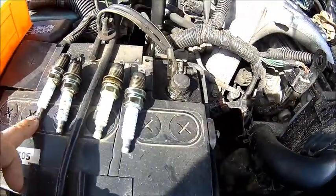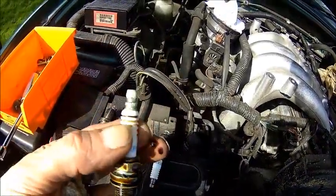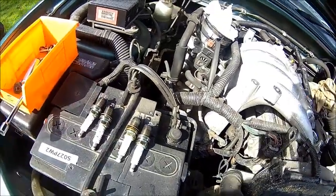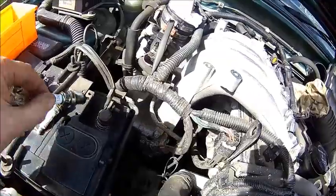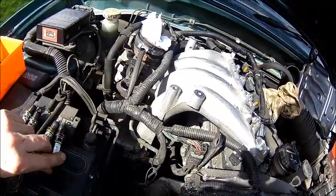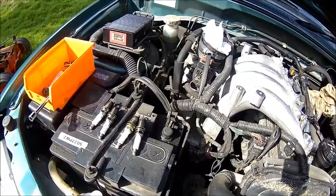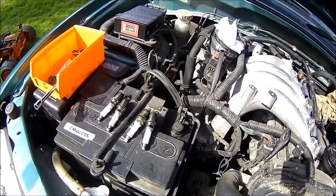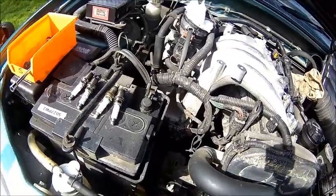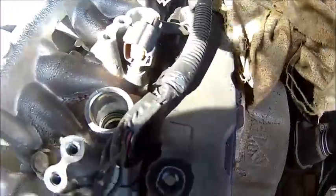Here you can see the situation. That's number one, two, three, four. Number three has some significant corrosion. And the holes down there are pretty oily. So we need to find some of these spark plugs — they're FR5B. I'm pretty sure I don't have any of those; it's a very odd bulb-style spark plug. Worst case we just clean it and put it at the front. I'll also run a rag down there to get the oil out — it's really oily down there.